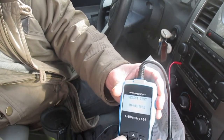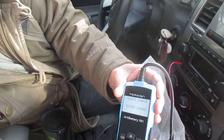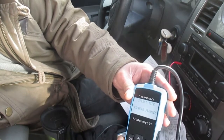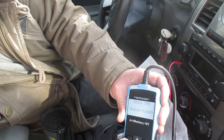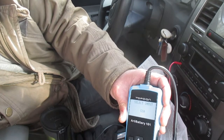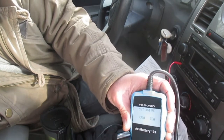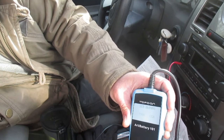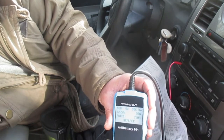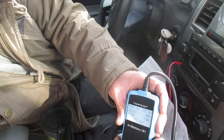Back in the vehicle — hit OK, English, in vehicle, arrow down to after charge, hit OK. We selected regular flooded, and our cold cranking amps are 730. It comes up — let's click OK on the 730 amps. It'll probably come back and tell us the battery is getting weak. I think it says state of health is around 0%.